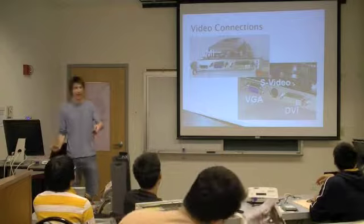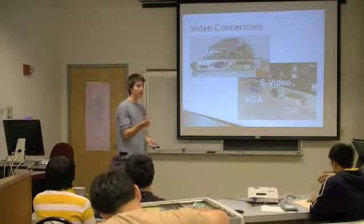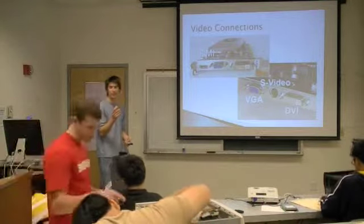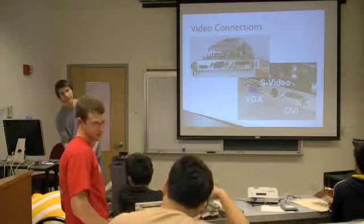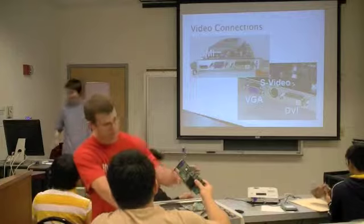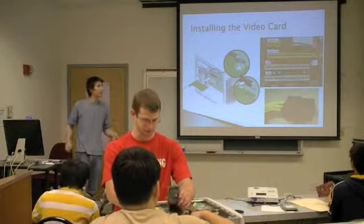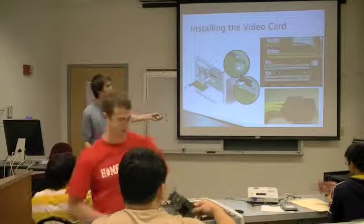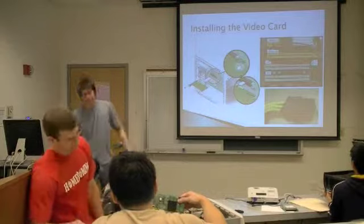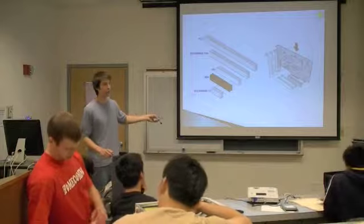So what kind of ports? I think some of these will have DVI outs. You can check on your video card, or if you have integrated graphics. Is that a VGA? Yeah, we have VGA. Okay, you guys have VGA. You guys have DVI. All right. So let's go ahead and install the video card. If you were installing a new card, you would use the PCI E16 slot. But like I said, you're going to be using the older AGP slots, which are coded in brown.